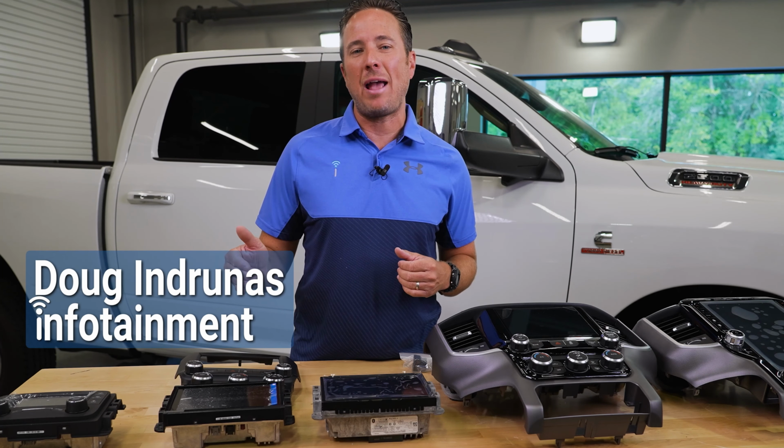All right, so we have our screws removed. There are 10 Torx T15 screws, so we'll set those aside. Now we're just going to lift up on the panel and push the bezel forward to release it. We're then going to take the bezel that's included with the kit and come in from behind and set it in. Now we can take those same 10 screws and reinstall them into the bezel.